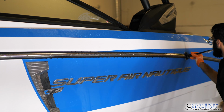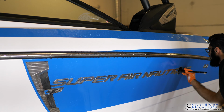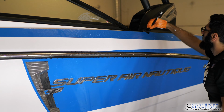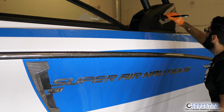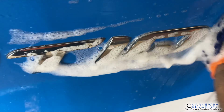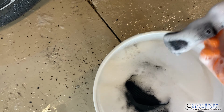Now, again, guys, I think I mentioned this before. You're going to have hard water spots, but if those spots and mineral deposits have been left on the surface long enough, they can be turned into etchings, and I'll show you that in the next few clips to show you an example of what an etching looks like rather than just a water spot. But again, guys, POV view, spray it on the surface, go ahead and wipe it down just like you were washing off a vehicle. Very simple, very easy. Continue this process and make sure to go ahead and rinse off each section thoroughly after you're done cleaning it up with your acid-based solution. After that, guys, we're going to go ahead and move on to the next step, which is the alkaline-based degreaser / all-purpose cleaner to go ahead and neutralize the acid solution.